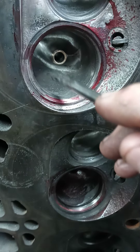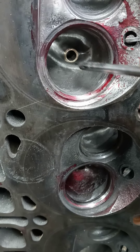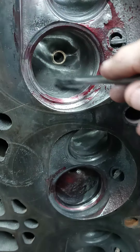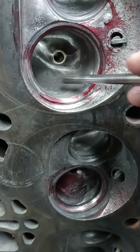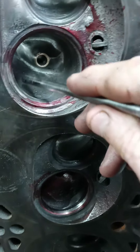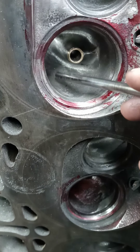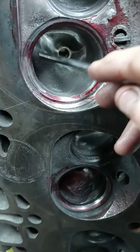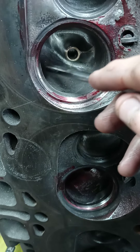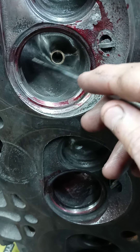The only discrepancy to me would be where it might shear the fuel, and that would be down at the bottom. The way I do heads most of the time I'll smooth some areas out around there, but I don't think it hurts the intake port at all if you left it completely bumpy all the way through, especially when that fuel is jumping around going to the top. I like the floor bumpy to break the fuel up. Anybody with a 460 and a stock port — if you're just cleaning them up for performance — I don't expect anybody to do what I'm doing here raising the floor.